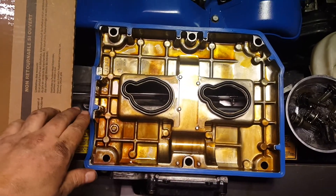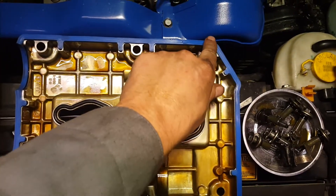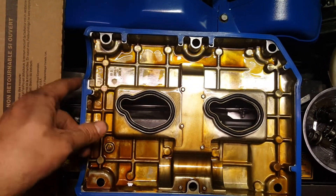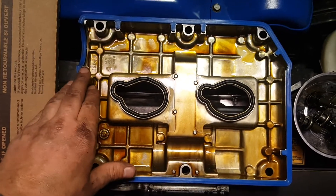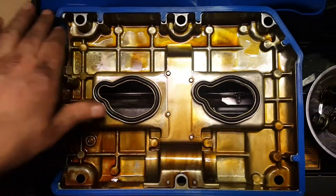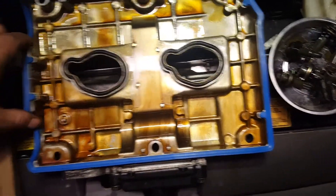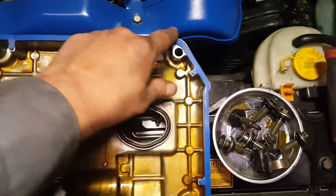The other reason I knew the valve covers had been leaking is that when I removed the old gasket, there was actually quite a bit of oil down in that valley and down inside where the cam seal arch is. I know it had been coming from this part of the valve cover because there was oil all the way down here. This valve cover was completely oilless when I put the engine back together, so it was all clean on the other side — it was just on this one side, leaking out the back of the valve cover right where this bolt hole is.